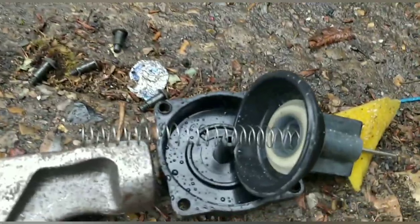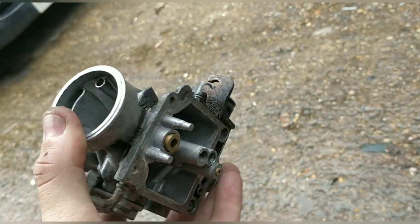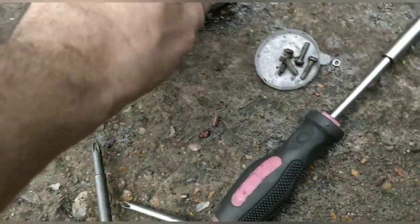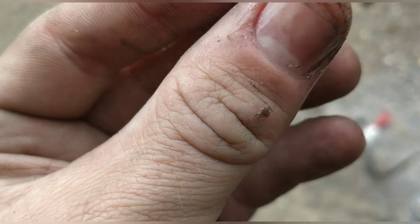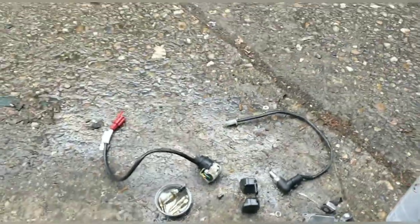The reason I've taken the diaphragm off is that the diaphragm must go nowhere near the carb cleaner because it shrinks it. So when you're cleaning all this out with carb cleaner, you don't want any to fall on that rubber diaphragm because it ruins it. You get it like this and spray it all the way through — just clean everything out. Then you look at the jetting. What main jet's in here? I believe it should be 80-ish — and it's an 82. So that is a standard jet.